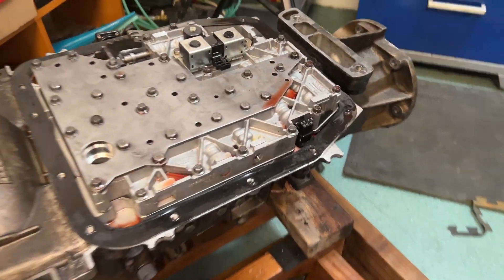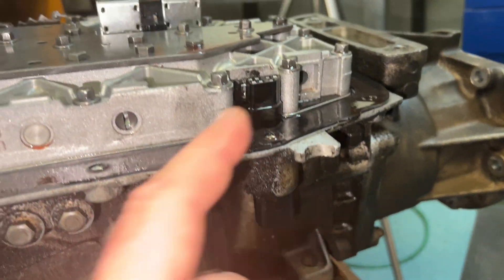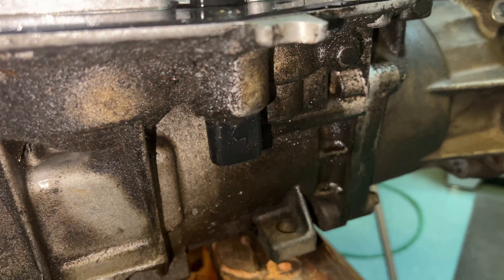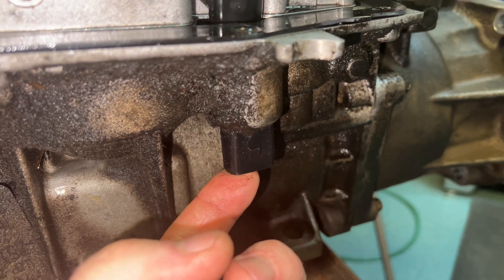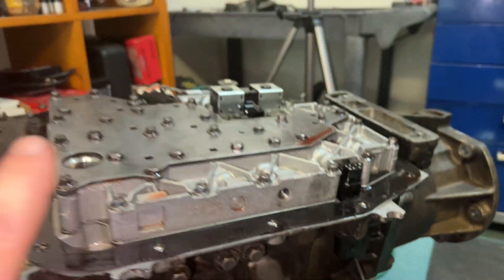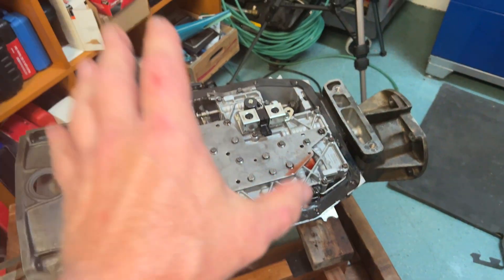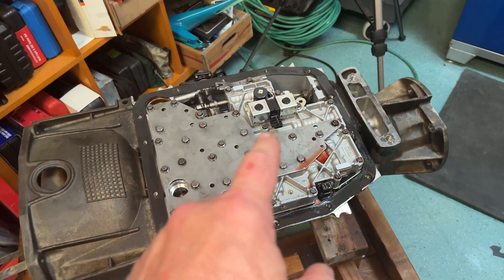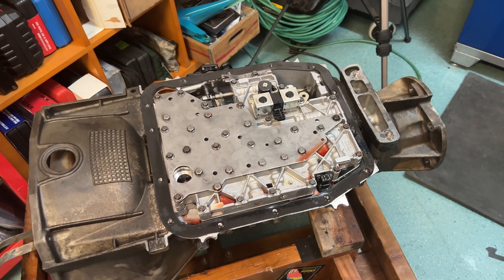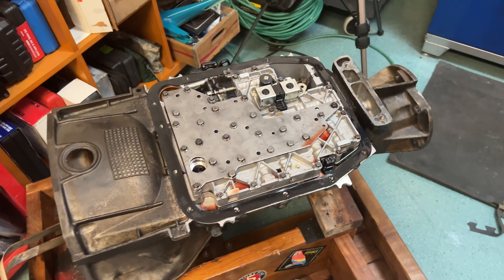With that snapshot of the diagram, what you can do before pulling the pan off to get to all this is check the connector. Here you can see it coming through the case — there's the connector right there. Using the pinout I showed you, you can check each pin for continuity through the solenoid or the proper resistance. That makes it a lot easier than taking everything apart and draining all your transmission fluid, only to find nothing wrong inside. Fortunately for me, it was the solenoid pack — a brand-new solenoid pack that failed. I'm going to replace it now and get this truck on the road. Don't forget to give me that thumbs up — I'd love to hear from you in the comments, and I'll see you next time on Driving Intelligence.